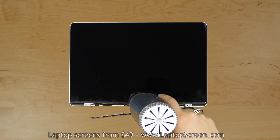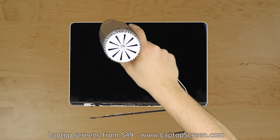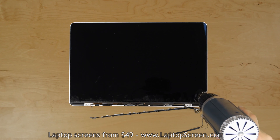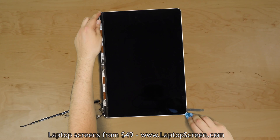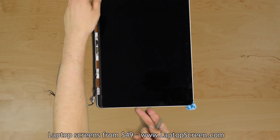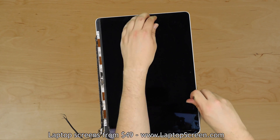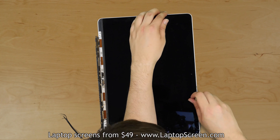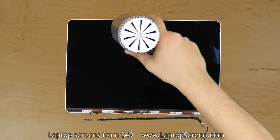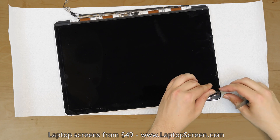At this point, the display assembly can be heated with a heat gun. The point of heating is to loosen the adhesive underneath the screen. A hair dryer can also be used instead. The entire assembly should be hot to the touch but not burning. Proceed on prying out the display from the assembly with a set of prying tools. If the display is not cracked, it will be after this. There is no practical way to remove a retina display matrix from the assembly without completely destroying it. You can use the heat gun to reheat the display assembly as you go along. Place the display assembly on a paper towel to better catch all the tiny shards of glass that will be coming out of the display.